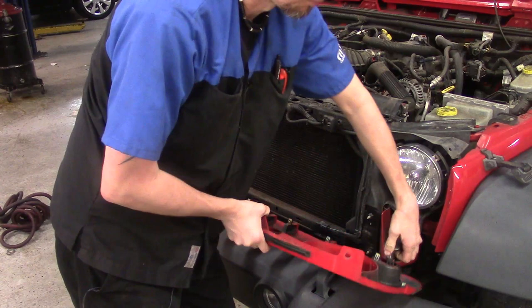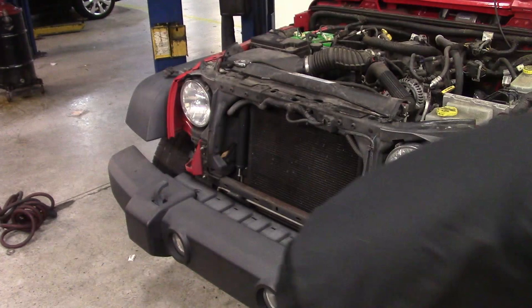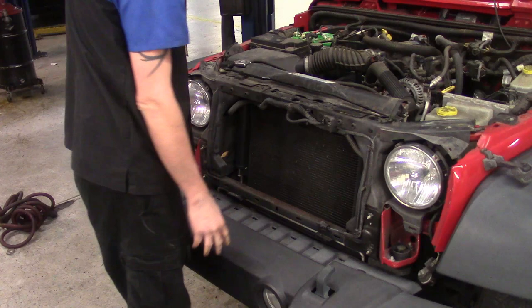What I like to do is just twist it and get the bulbs out. I'm not too worried about the connectors — I can fight with those otherwise. I just twist it and get the bulbs out, and I'm good to go. Now we can go ahead and gently, neatly put our grill off to the side and get a little more access to the AC condenser and the bolts that hold it to the radiator.